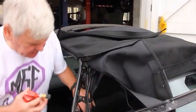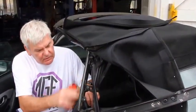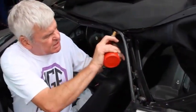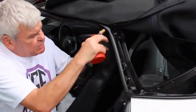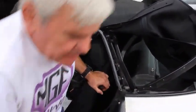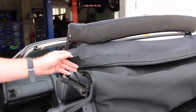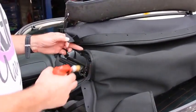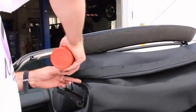And now we apply one coat to the metal. The reason we only need to apply one coat to the metal is that the solvent in the glue, hence the reason why we use the solvent glue, reactivates the solvent on the frame already. Yep. So, having applied the coat of glue to the B pillar, we now put the first coat